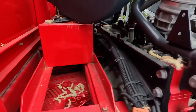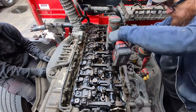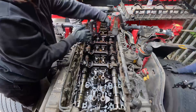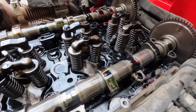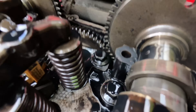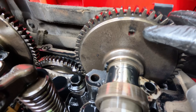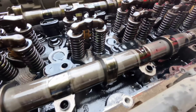There are marks for the fuel pump camshaft but there's no way I'm fitting in there to get to that, so we'll just have to wing it. So that's all our rocker shafts out now. We're just left with our camshafts — hopefully you can see the timing marks a bit better now. There's one there, one just there, and obviously these point at 12 o'clock. So we'll get the camshafts out and get the bearings changed, because it would be stupid not to change them.